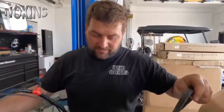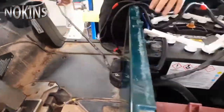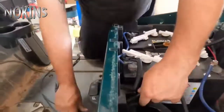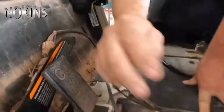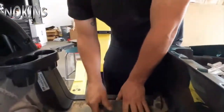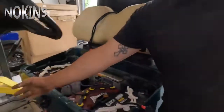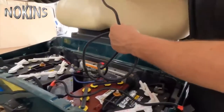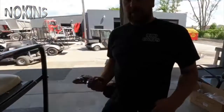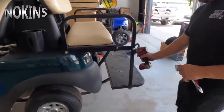Now we have our wiring harness and we're going to install it on the cart. We'll take it and fish it through to here. This is going to take the two small wires — yellow and red — and put them down here for right now. The rest of the harness we're going to put down in this little channel and run it up with the harness to the cart. Now that we've got the front half of the harness in, we need to run our taillights. Quick installation note: red is passenger side, white is driver side. To cut the hole out, I like to use a step bit — very easy to do. You could use the tool provided in the kit if you don't have one.